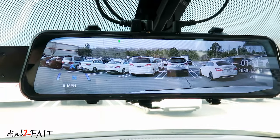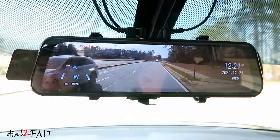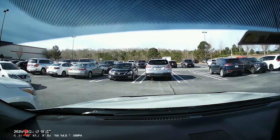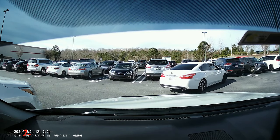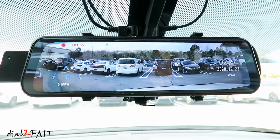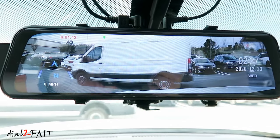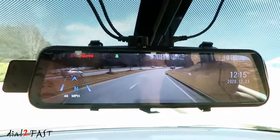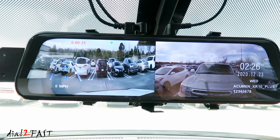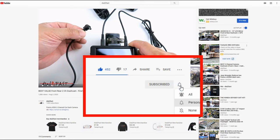So as you can see, this Acumen XR10 Plus mirror dashcam has a lot of great features built into it. The LCD display is nice and clear and doesn't have as much glare as other mirror dashcams I've tested. The daytime recording is quite clear and you're able to read license plates in front of you. With the rear camera, it does require some ambient light or street lights to give the picture proper exposure. The parking monitor function works very well and is able to detect any impact and record a short video. If you install the hardwire power cable, the dashcam can do continuous time-lapse recording. This dashcam also has built-in Wi-Fi, but to view the video you do have to download the video first and the download time is a bit slow — it might be easier to use a card reader. As for the GPS antenna, it will record the speed you're traveling at in the video, but there is no PC software to play back the video and show you the driving coordinates. If you want to learn more about this dashcam, check out the link below. Thank you for watching. To support this channel, remember to click thumbs up, subscribe, and turn on the notification bell so you get notified of new videos.